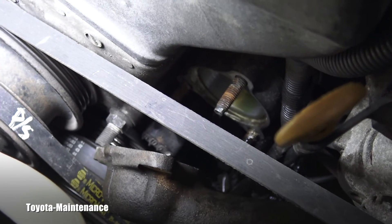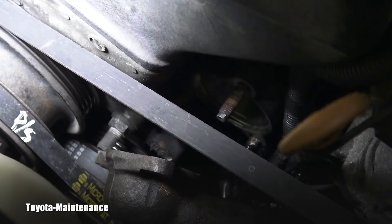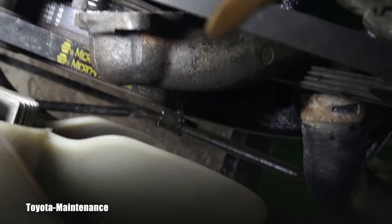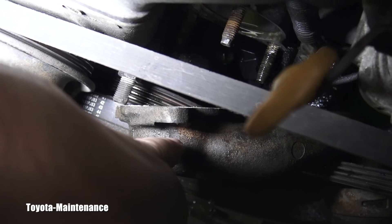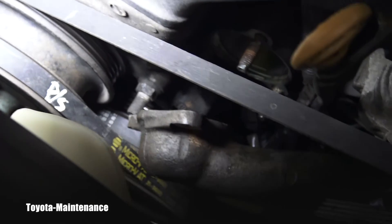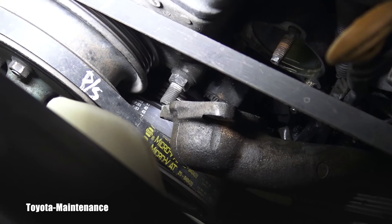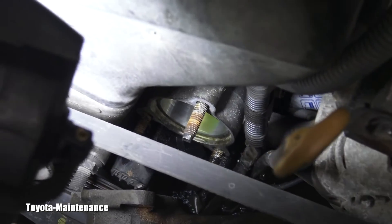The third nut fell down into the catching pan. I'll put the thermostat on, give you another shot of it, then close it up. These bolts will be torqued to 20 Newton-meters — there's no need to overtighten it. The rubber gasket provides the sealing function and will make sure it's not leaking.